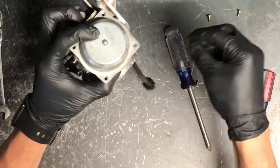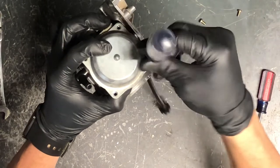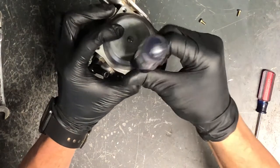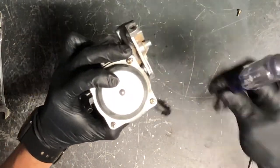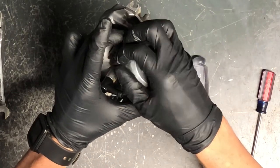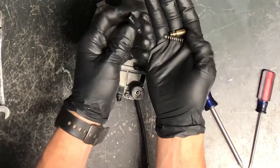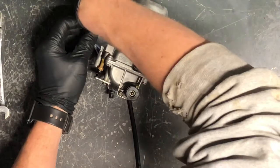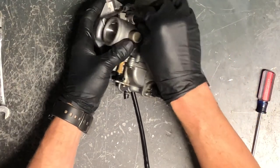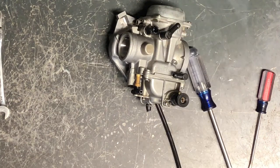I always keep pressure on the cap while putting the screws in to verify it doesn't come loose and pinch the diaphragm. You want a completely airtight seal here — any air leak causes problems. Keep your finger on it until at least three screws are in. Going back together, make sure you've got your choke and plunger — a lot of times the cable stays on the four-wheeler during a carb clean, so you can just slide the plunger in with the cable and spring, put the cap on straight, as they're plastic threads and cross-thread easily. That's the carburetor on a Kawasaki Prairie 400.